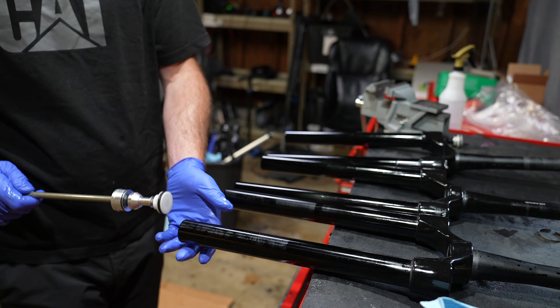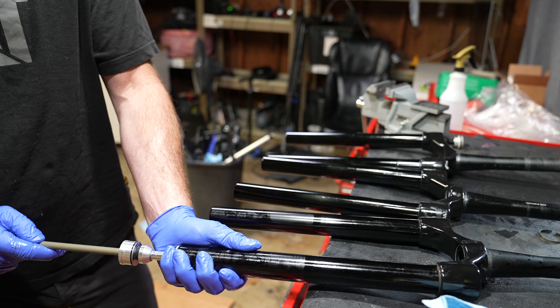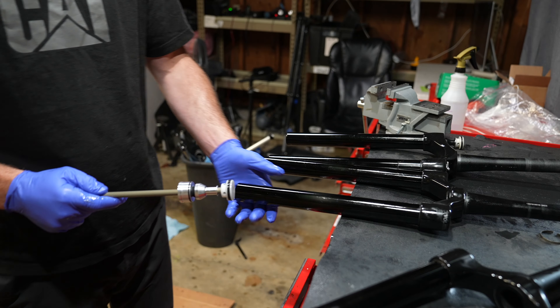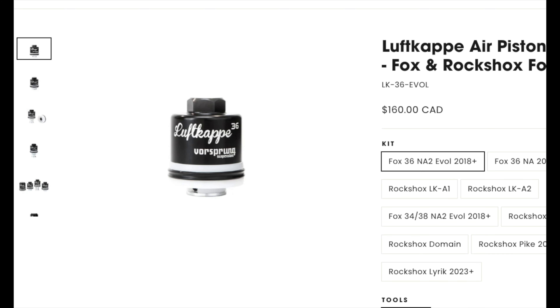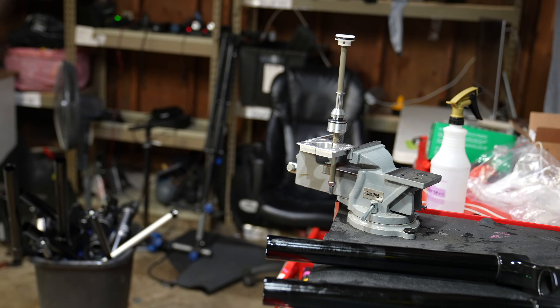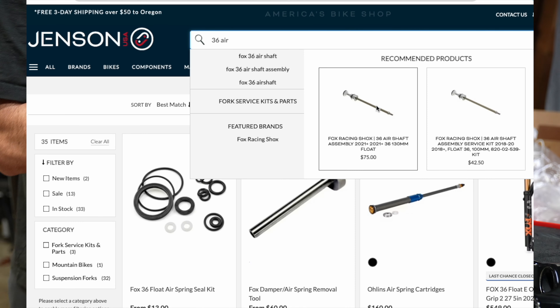Often I learn a lot making these videos. From all this comparison, an old top-end Fox 36 is actually the best budget fork — it has the best bushings, the best chassis, the best damper, and the best air spring. Fox dampers are super reliable, they age well, they stock parts for them for a long time, and aftermarket companies will rebuild them and provide parts. Fox forks are not a throwaway product like Suntour, so buying an old one is pretty safe.